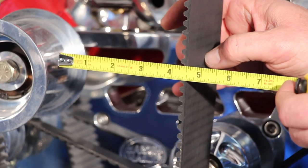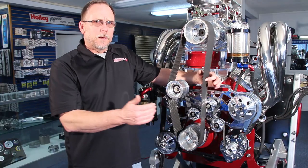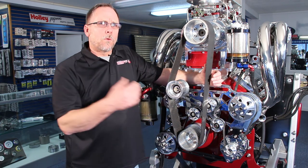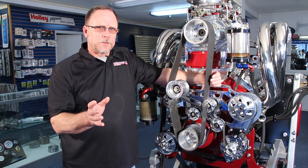You're going to go from an inch and a half total travel to about a half an inch. This is going to be the same whether you have a standard style of rubber belt or if you run a Kevlar belt — that makes no difference there.